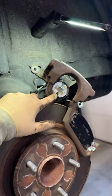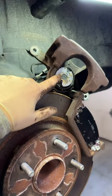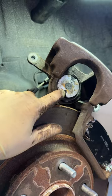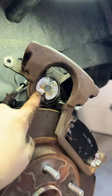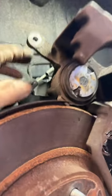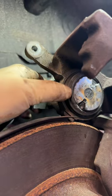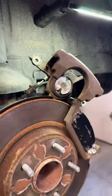This particular rear brake setup — we're replacing the pads and we have to push back this piston. Now this piston is a turnstile piston, the one where you got to use a tool like this that'll basically push the piston inward and allow you to rotate it at the same time. What happens on these is this boot will stick to the piston, and as you're turning it, it'll start shriveling up and could potentially damage that boot.